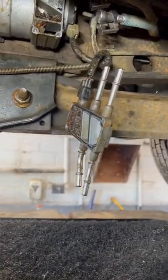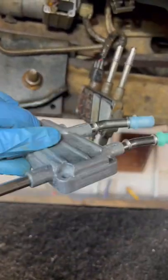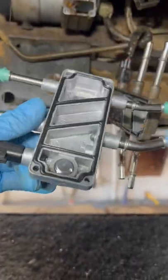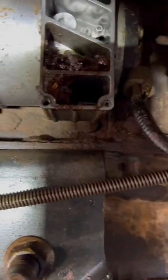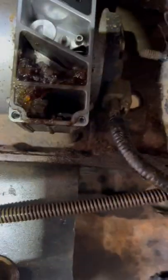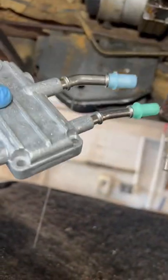If you're wondering how to fix this problem, you're going to want to buy a new header panel — I'm not sure of the technical term, but that's what I call it. Clean out all the junk and gunk up here, install this new header panel, and you will not have any more water and fuel sensor problems.